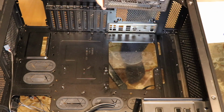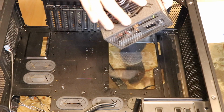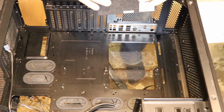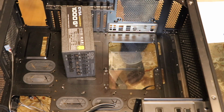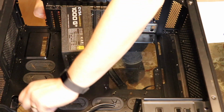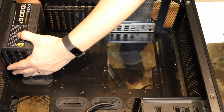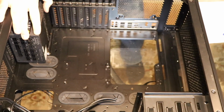So you're pushing all that hot air, then you're pushing all that rug filaments, because there's so much dust in a rug. Exactly, just sucking all that rug dust up in there, and your power supply will fill. I knew a guy who killed 2 or 3 power supplies a year until we figured that out. Just a little tidbit, man. Most people don't know that. But unless you're putting it on a rug, it just slides usually right there in the case.